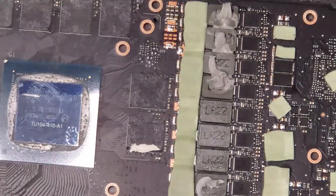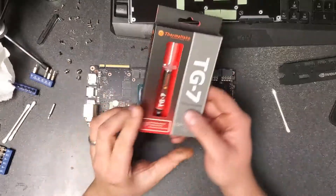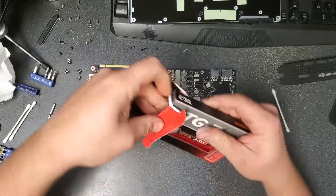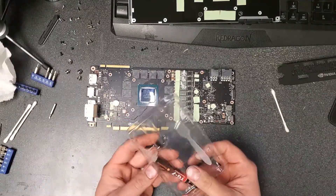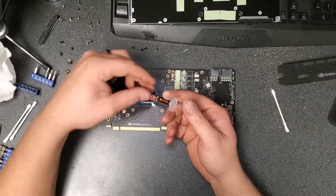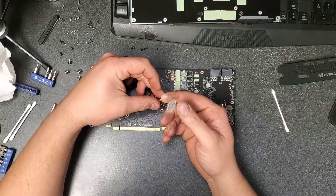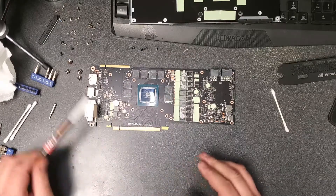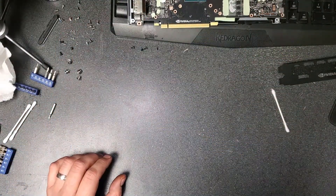The thermal paste on the VRM area is still puzzling me — I don't know why they didn't just put a thermal pad there. Anyway, here's the thermal paste I use: TG7, bought at Best Buy for about seven or eight dollars a tube. Just take the cap off and put a small amount right in the middle of the SOC — it's kind of a feel thing. You don't need a whole bunch, just a little blob right there in the center.